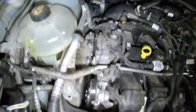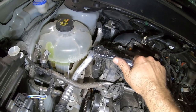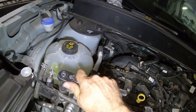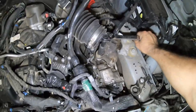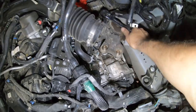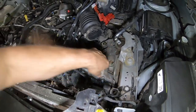Last step — making sure everything is tight with my trusty ratchet. Just tighten up here. If you feel so inclined, you could use a torque wrench — I'd say 65 foot-pounds would be decent enough. For stuff like this, just get it really tight. There we go. All those are done. Engine's dropped.